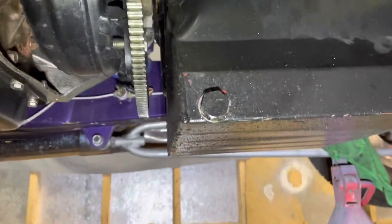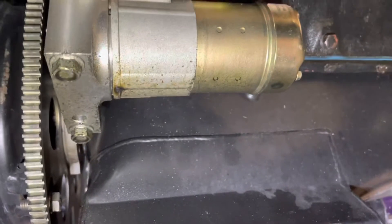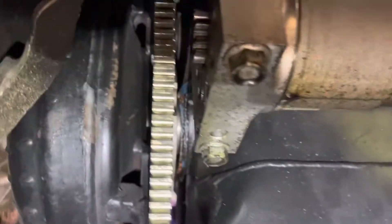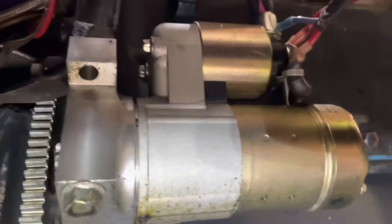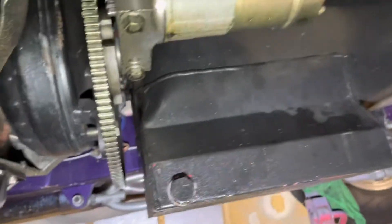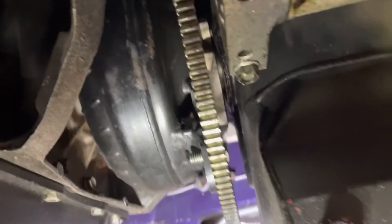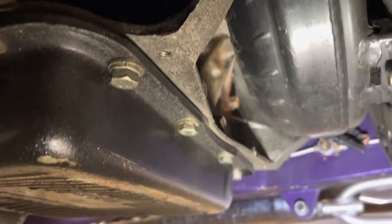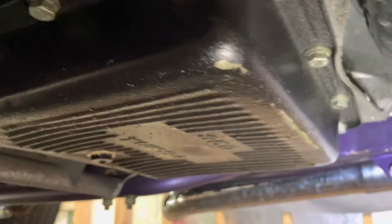Moving up to the oil pan. That little bit of oil you see on the starter — I already know about all that. When it has the mufflers on it and I'm getting in it, the back pressure pushes the dipstick up. I need to put a locking one in it, because I'm sure the ring gap's got a nice little gap in them for the nitrous. All torque rear bolts are tight, no leaks coming out front. The pan here is a little wet on the trans side.